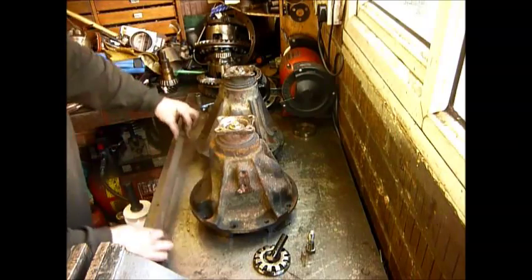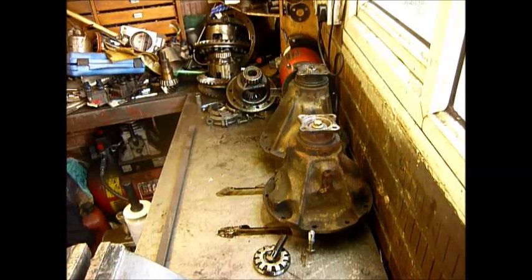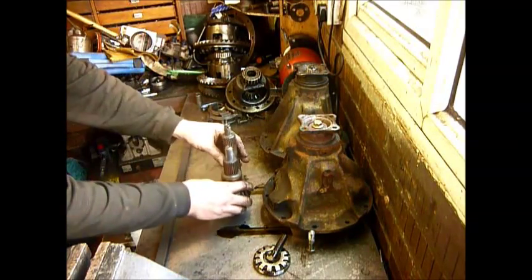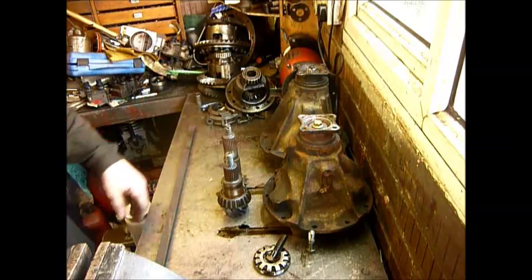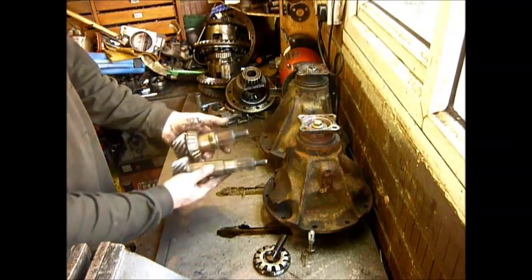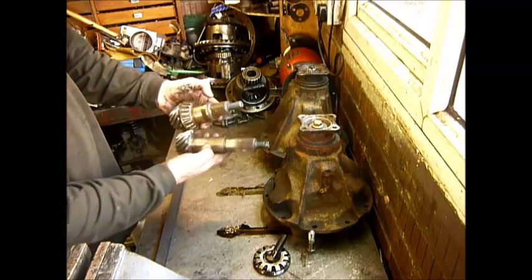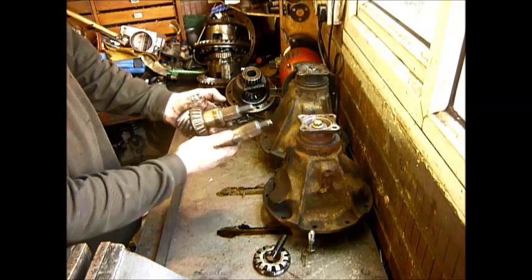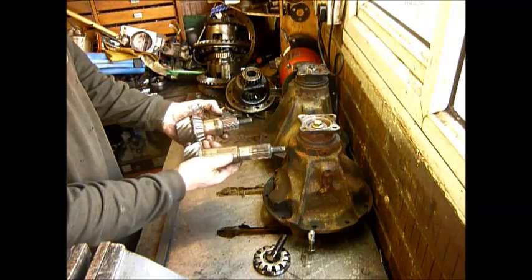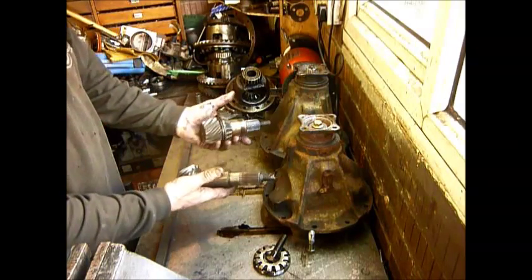The way this is done is via the pinion. Here's a short nose pinion and a long nose pinion — short and long. Both have a bearing, though this one's bearing has been removed. As you can see it's substantially shorter and actually quite a bit thicker, so because it's shorter and thicker it has less tendency to flex, whereas the long nose pinion can flex away from the crown wheel causing things to break.